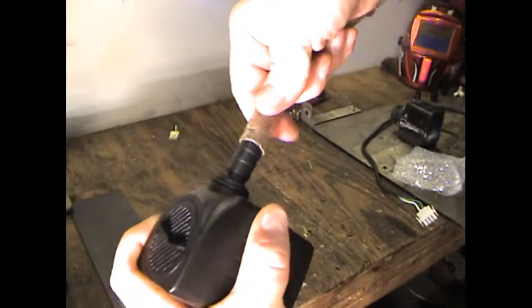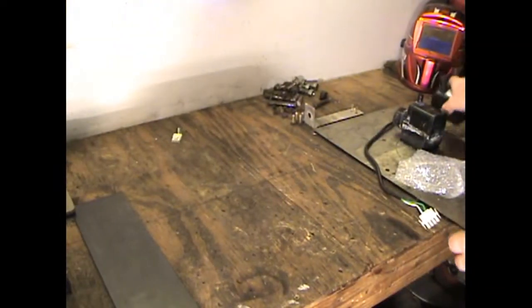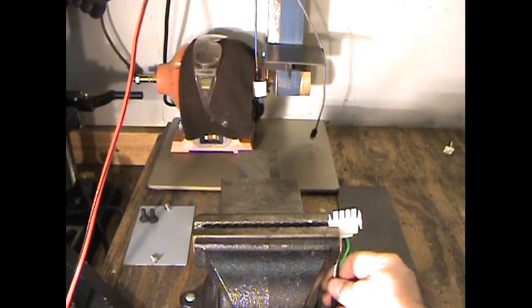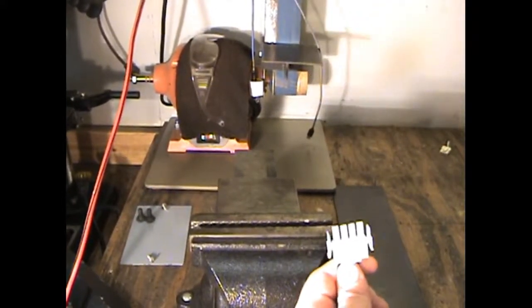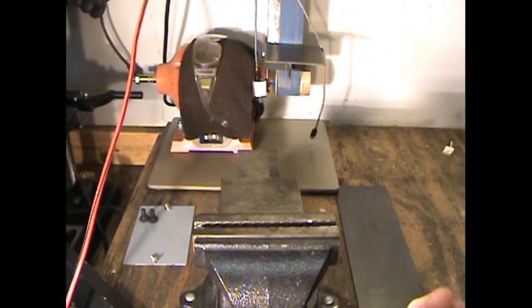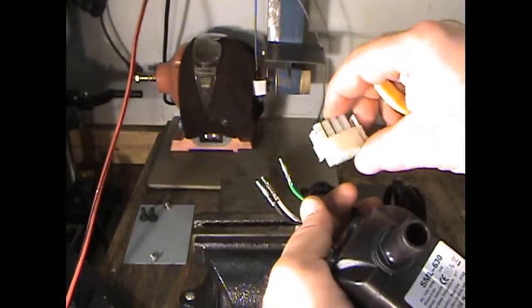I need to get it a little bit wet to get it to slide over. The only real problem is this thing comes wired to be plugged into the wall, whereas the old pump is not. So what I did — I put this thing in my vise, locked it in, took a pair of needle nose pliers, and just jammed each one of these connectors out so they come out. Now I have the correct plug. All I have to do is cut off this plug, crimp these little things onto the wires from here, slide them into this adapter, and this thing will be ready to reinstall.